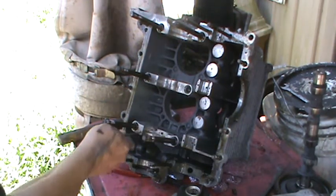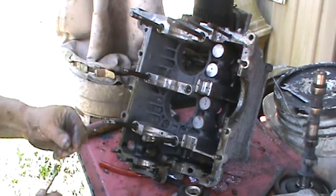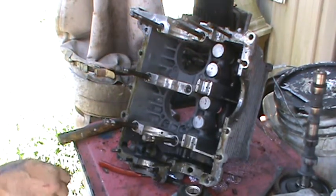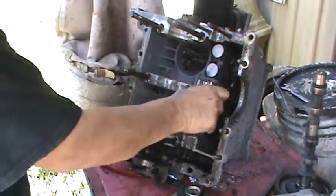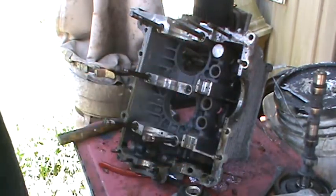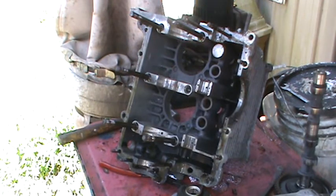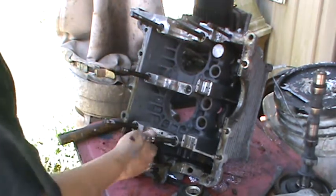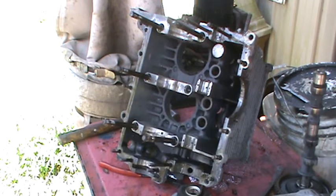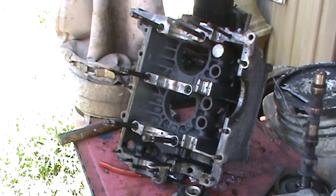We'll take this part and get some dowel pins out of it. All these little parts are hard to find — a lot of the aftermarket parts are cheap and not quite correct, and you can have some issues. We got a good set of cam bearings. I've been saving old cam bearings now because the new cam bearings are so crappy. I find myself using used bearings in some situations, especially in the cam area, just because what you can buy new is no good. All right, well there you go — one short block disassembly. I'll talk to you guys a little later.